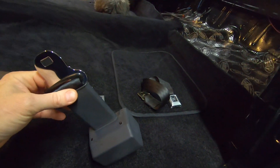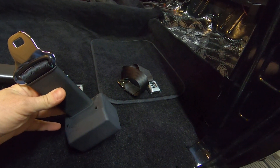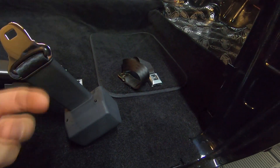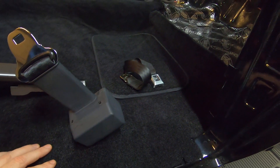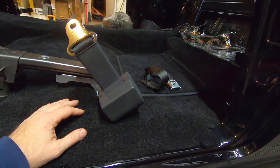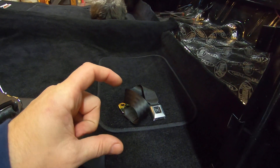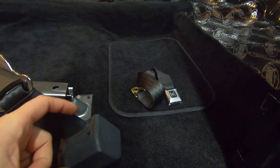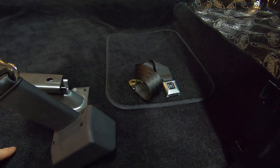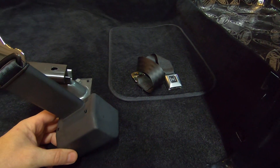I mocked all this up when I had the seat bottom in here. They come with little 90-degree brackets that you basically bolt down or weld to the floor, but to me they were a little too thin of metal, so I ended up doubling up the thickness of the metal. I done a 90-degree bracket and welded it to the floor — it's about two to two and a half inches long, the part that goes to the floor. I drilled three-eighths holes in it, plug welded those, and then fully perimeter welded it, so it is stuck to the floor pretty nice.